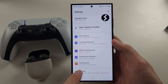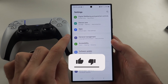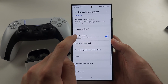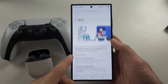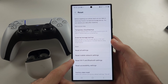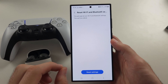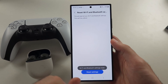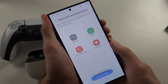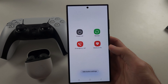Finally, if all else fails, from the home page of settings locate General Management. Scroll down and select Reset, then reset Wi-Fi and Bluetooth settings. This is listed last because it will require you to re-enter your Wi-Fi network and re-pair all of your devices. Once done, press and hold power and volume down, release when you see the screen, restart your phone, retry, and it should work.